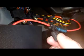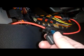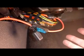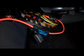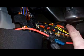Behind the seat the cable came along and I pushed it underneath this piece of plastic and came up here. This is a fuse holder — it's absolutely imperative to put this in. I soldered in the fuse holder, found the live and soldered onto the side of it with a 15 amp fuse. If you don't want to use this live, you can go directly to the battery through that little hole. Use whatever live you think will work — this is just the one I happened to pick because it's conveniently inside the van.